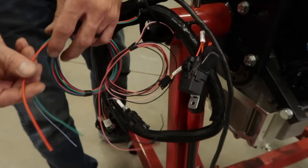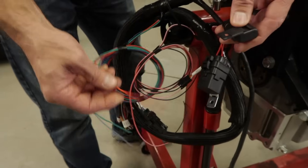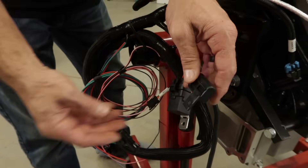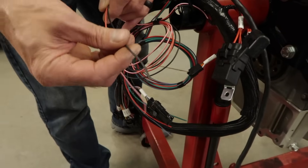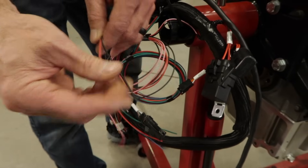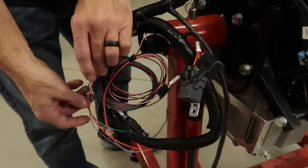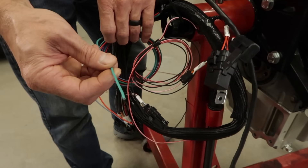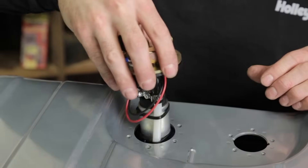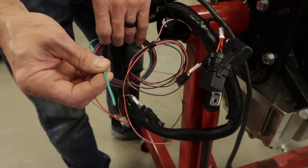Depending on your harness, you'll find several wires midway down in the wire loom. The solid red wire powers the fuel pump relay circuit and should be connected to the battery or a clean constant 12 volt source. The black wire is a ground and can be connected to a good chassis ground. Our harness includes a dedicated fuel pump fuse and relay to power your fuel pump. The green wire can be run directly to your fuel pump to supply 12 volts of power, but if your fuel pump draws more than 10 amps, you'll need to wire in a separate relay using this lead as the trigger.